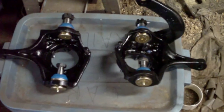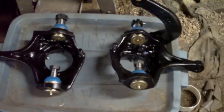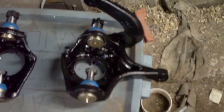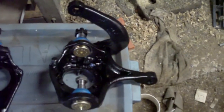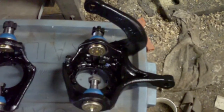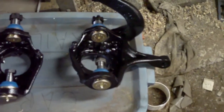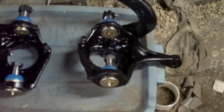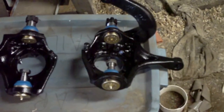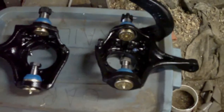The upper and lower ball joints are in. I completely disagree with putting the lowers in first — I think I would have had a much easier time with the driver side upper if the lower hadn't been in already. That was the only one I had a problem with. I had to make another sleeve for the bottom to press it in because I didn't have clearance at the top or on the steering arm. The end result is it's in. It marred up the bottom of the paint on the knuckle, but it's a work truck — I'm just doing this for preservation.